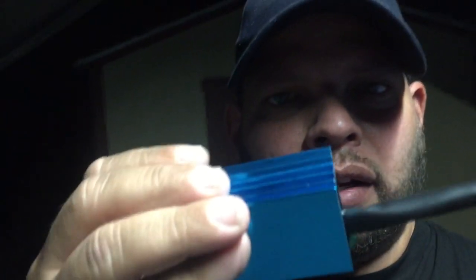I did some research online and everything came up as a carburetor issue, so I worked on the carburetor, cleaned it up — still same issue. I went on Amazon and purchased a CDI with no rev limit to see if that works, since I'm having issues with it revving up.